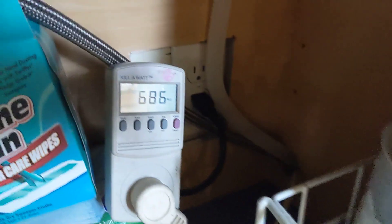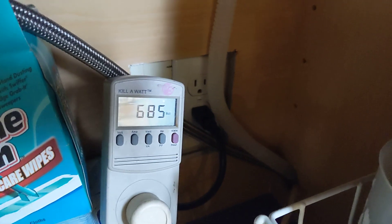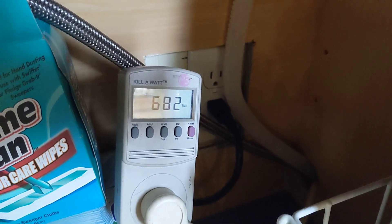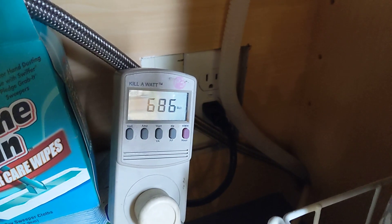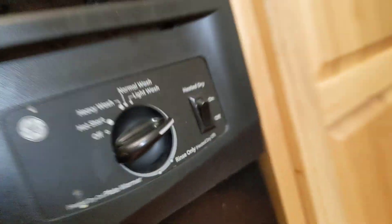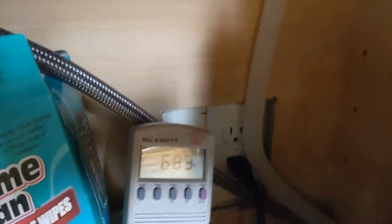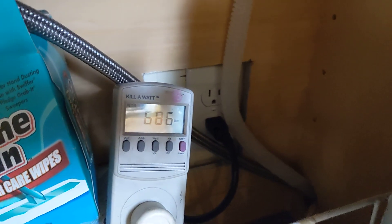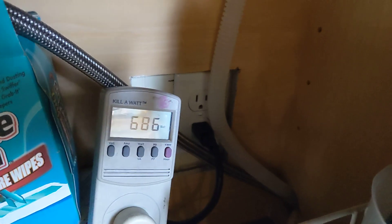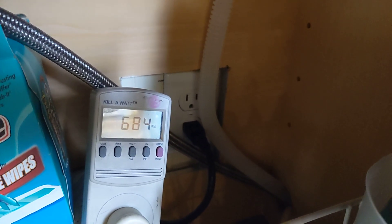I had to kind of force it a little bit — I basically turned the machine off and put it back in the wash cycle. And here you can see that it's consuming 680 watts of power in the main wash cycle, basically on this mechanical controller right in that position right there. So that tells you that the heating element, which is about 400-and-some watts, has been energized in order to heat up the water beyond the temperature it receives from the water heater. So yes, the dishwasher does in fact heat the water.